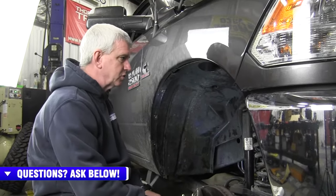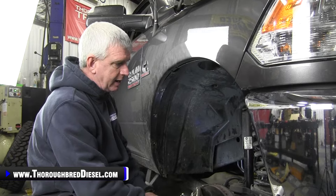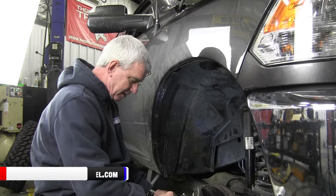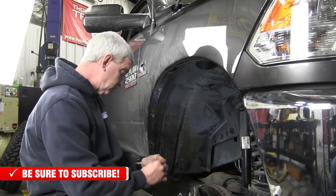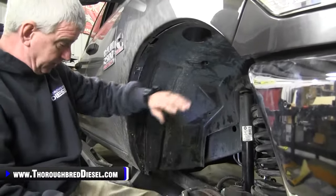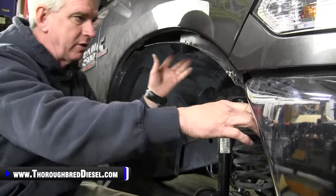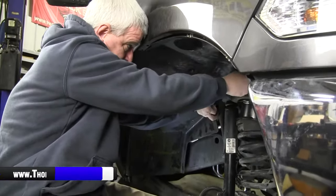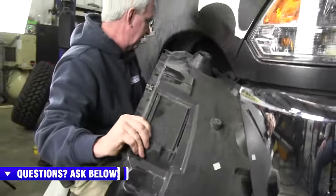We've moved down to the fender well — this is where a little bit of your work is going to take place. We got our coolant supply and oil supply lines off and all our wiring out of the way. The fender well on the Dodges, if you've done one of these before, can just be a pain. There are eight metric screws — six long fender well, two on the inside — then a couple of Christmas tree push pins on the inside. On the new model Dodges, what I do is start on the forward position and just kind of roll it out. It loves to hang in that shock tower — get it clear of the shock tower, try not to put pressure on anything, and roll it out. With the fender well out, you can see you've got a pretty straight shot at the turbo from here.